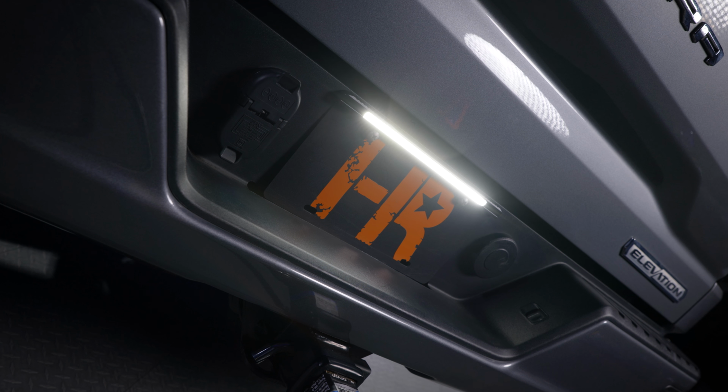First thing you gotta do is drop the tailgate, and you just got 2 screws right here. Using a T25 Torx bit, go ahead and remove those. All right, and that's literally it. 2 screws, and then it's just pressure fit. You're gonna pull it towards you now to remove it. There you are. There's 1 plug on the back side. Go ahead and remove that by squishing this right here and giving it a pull. And set this taillight off to the side.